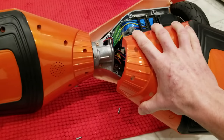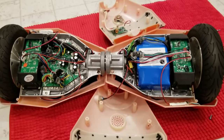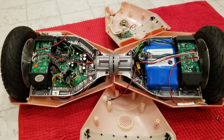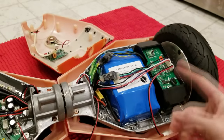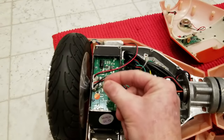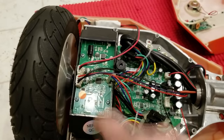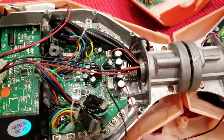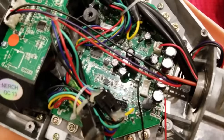After loosening the screws, the cover just comes right off — but be careful because you have some cords plugged in the bottom. Now with the back off, you can see the gyroscopes — the boards are right here and here. What you want to do is check all these components: unlatch them and re-seat them, making sure they're clipped in correctly — you should hear an actual click. Also check any of the wiring lines going in. This is my charging port, which I've disconnected and is right over here.